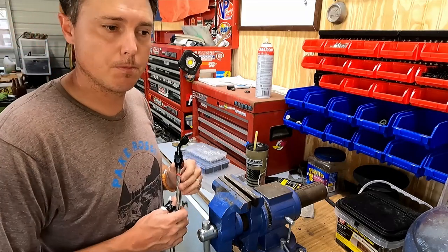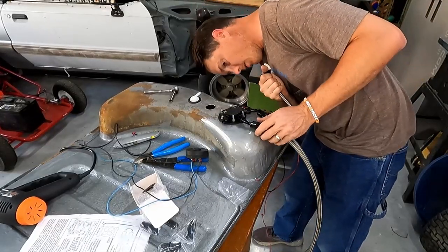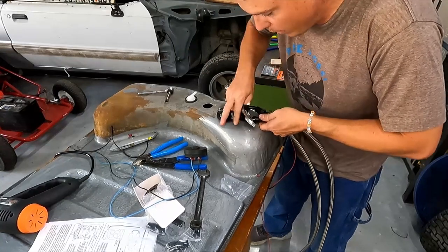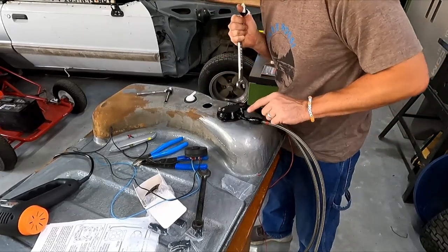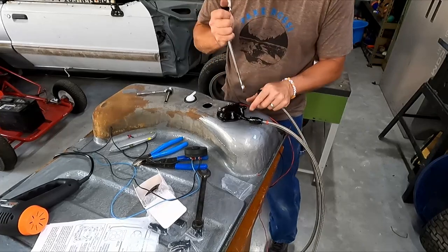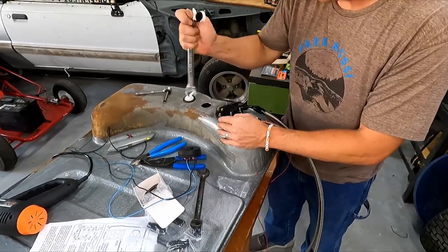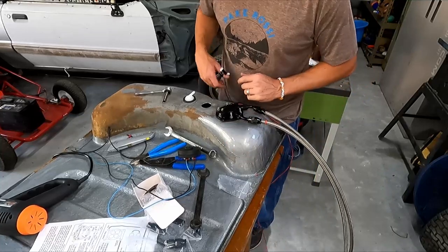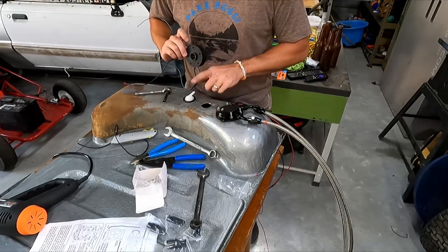Now let's put these on. I'm going to leave it connected and cut it whenever the time comes, because that just keeps stuff out of the system. Make sure these fittings are tight before you start tightening your fuel lines. I just realized I put these connections together dry — I didn't use any lubricant. In the video I watched, they used lubricant. Learn from my mistakes. Let's tighten up the vent. The Pinto's got a fuel pump. Also, we have this — this is the Holley Easy Fuel Sender. I already drilled the hole for it.